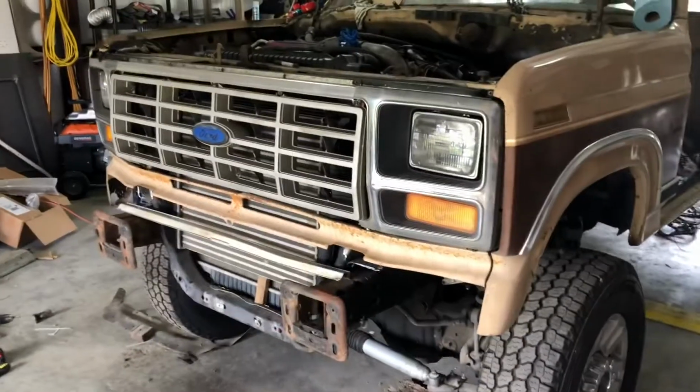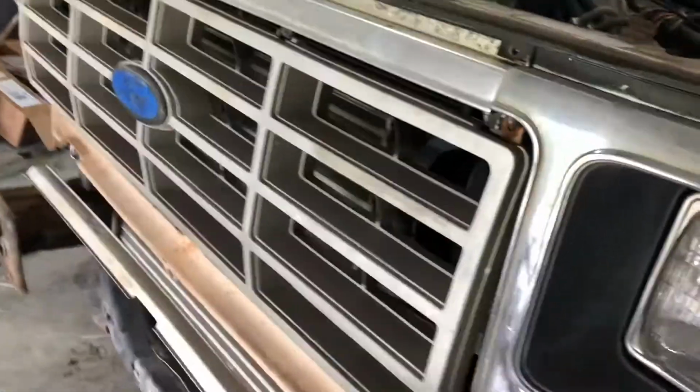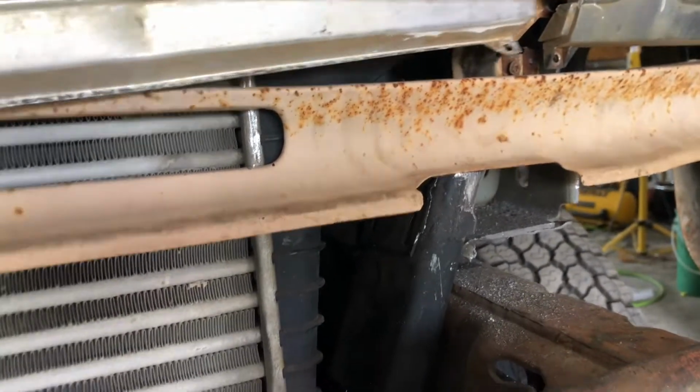And I know we're talking about a trans cooler mounting it, and I found one. I found a 4-inch by, I can't remember how wide, for a Duramax, and it would have fit up there, and this will get sucked in. You can see these are all busted up. It's all gonna get replaced. See, that mount's busted up. The only mount that's good is that one. But you can see that's the top of the intercooler, and then back there's the AC condenser, but you've got the hood latch, so a trans cooler wouldn't fit. So we're sticking with what we got in the back. And then of course this trim is supposed to go up here, but it's all busted up too, so we'll put all new stuff here, but that'll get sucked in, and yeah, it'll work.